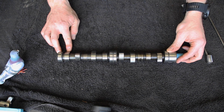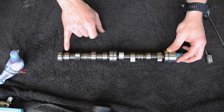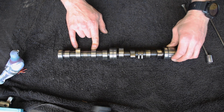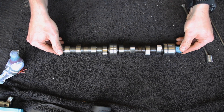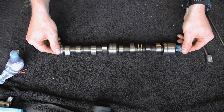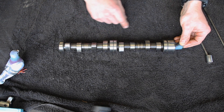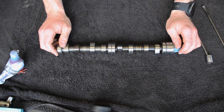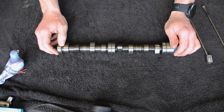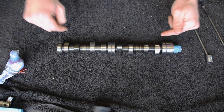Essentially to do all cylinders the camshaft doesn't need to be that far out, because you can do valve number eight and number six, keep turning and do number four, number seven, number one, and number three, and then number five and number two. That is as easy as it is, and it probably takes one crank turn, maybe one and a half. It is very straightforward and it's probably the best method to use for a classic Mini — it's simple and it just works.